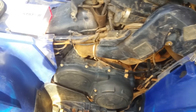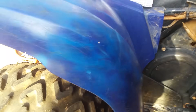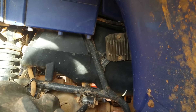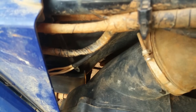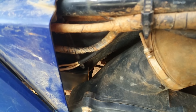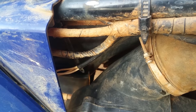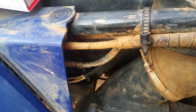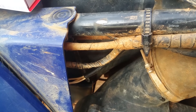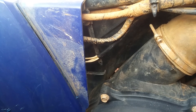So then we went back to the regulator slash rectifier — it's kind of hard to see, but it's right there, that little metal box. The stator, which is what provides the power to the voltage regulator slash rectifier, is those three white wires right there. It comes from the other side of the motor. On four-wheelers and boats, they go bad a lot because they get hot and burn up. The stator wires go into the regulator slash rectifier.